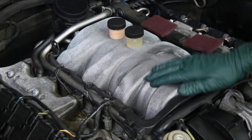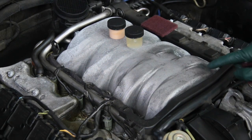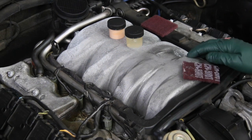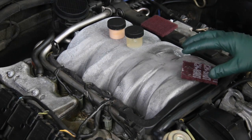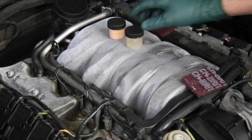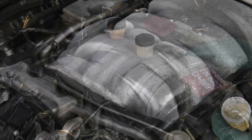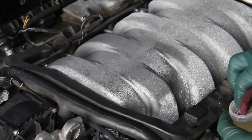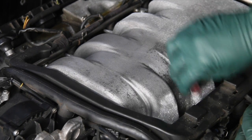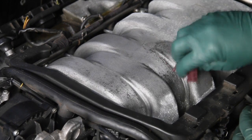I've started on this and it's starting to look pretty nice. If I wanted to take the time and continue to work this Scotch-Brite pad with the anti-corrosive gel, I could get most of this spotting out of here. It's going to be tough to get some of the deep dark spots out, but you don't want to use any kind of acid on this magnesium because it's going to be really hard to neutralize it and stop any future acidic reaction. The more you rub, the shinier it's going to get.